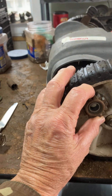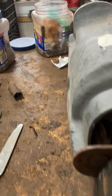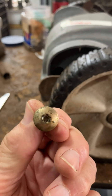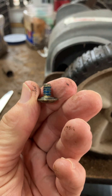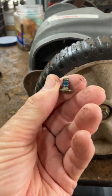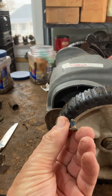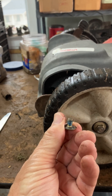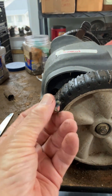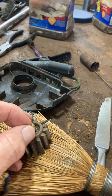These are the gears that are in there — they catch the outside of the wheel and turn. They're held on with a brass screw, so you have to get one of those star-shaped screwdrivers. There is Loctite on these, so you've got to be prepared to put some oomph on it. It's going to want to spin, so you'll need to go to the opposite side and get a big pair of pliers or something to hold the axle still in order to get some purchase on it. I've taken off both gears on both sides.